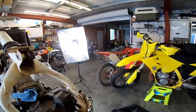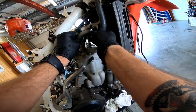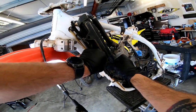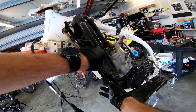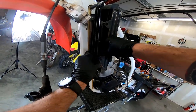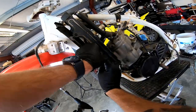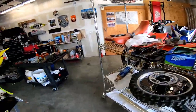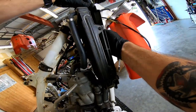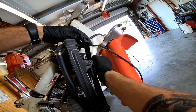You've got three 8 millimeter bolts on both sides and this little crossover tube here, which Honda still used until the last gen of the CR250. Go ahead and very gently remove your radiator louvers — these are just plastic. These ones are super old and they're the same on bikes all the way up to modern day. I just don't want to break them — I don't know how hard these are to get for a 1990. On the rack, next side. This one's a little stiff — try the back side instead. That seemed to work a little easier without breaking.